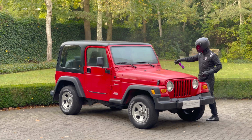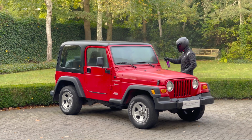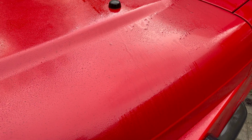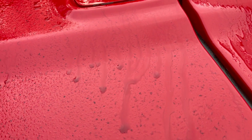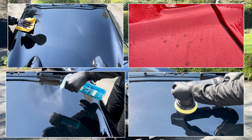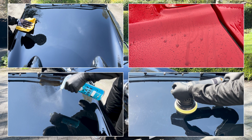We don't like using iron remover products on our Bug-Eye because this process involves acid and water, and Classic cars are notoriously rust-prone. Besides, our car only has tiny enclosed drum brakes that don't emit hot brake dust, so we skip that step. Depending on the state your car paint is in, you want to clay bar and polish it first before applying a ceramic or graphene coating.